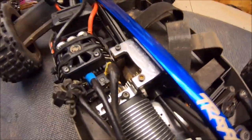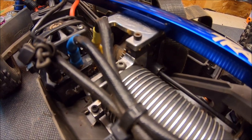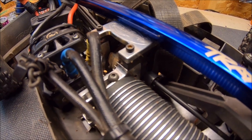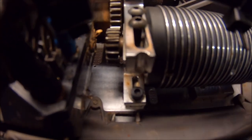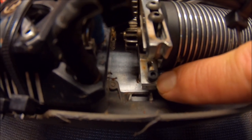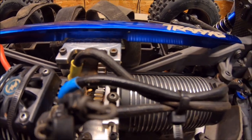Here's a quick shot of the inside with the chassis and also the M2C Racing motor mount, which is another game changer. The stock mount is two different pieces — you've got your stock mount and the center diff mount, which is plastic, and it's separated from the actual motor mount. So with the stock chassis, especially under extreme conditions and chassis flex, you're going to be separating your mesh and breaking spur gears. With this one you can adjust your mesh from the top — it has a nice slide, and once you get everything locked in you tighten it down with a screw at the bottom so the mesh can't move. Really sweet design by M2C Racing.